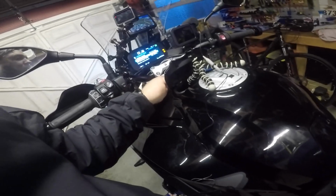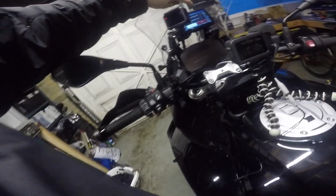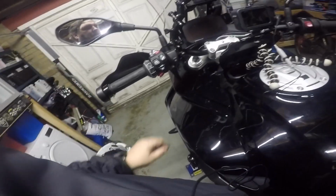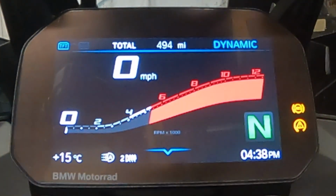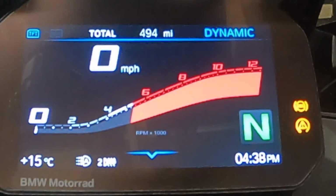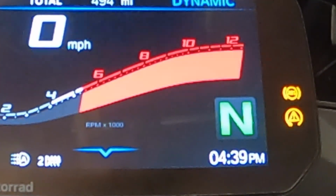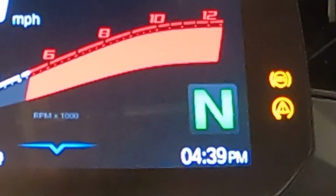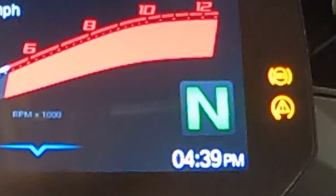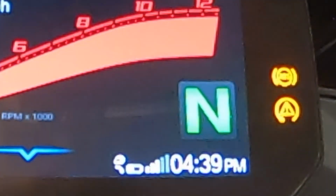And it's all automatic. Literally, when I switch off the bike, it all will switch off, as you can see here. I'll turn off the NAV6. Yep, and then I'll turn the bike on. And as long as my helmet's on, my phone's on, it will automatically connect. Now there is a delay, and you'll see on the TFT, bottom right hand corner by the phone, some icons which will pop up to show you that it's connecting. Those icons will be a picture of a helmet, a Bluetooth image, your battery level, your signal strength, and your phone.